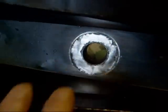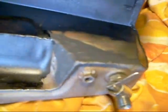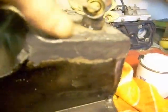Soldered around my centre hole because I had a leak around here. I'll cover that up with some tank sealant. And around there I've used some plastic metal, just around this weak area. It wasn't leaking that side, but I had a bit left, so I've just put a piece or a bit over there. Fill them edges in.